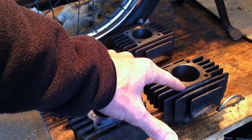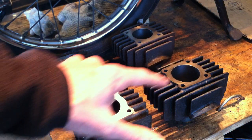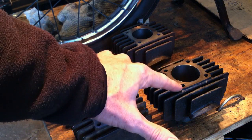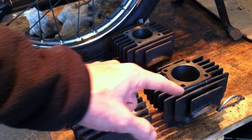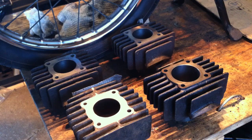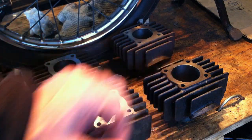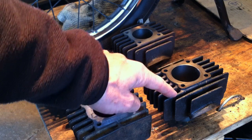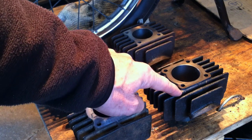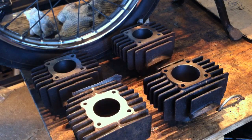I had one and a half millimeters off one and 1.9 off another. This YT60 Yamaha cylinder is 44 millimeters while the other three are 40. On the YT60 I didn't have any material taken off the top — what they call decking or milling the cylinder. Instead I had it bored out to accept a 45 millimeter piston, going up slightly in cylinder diameter.